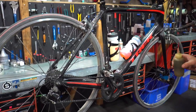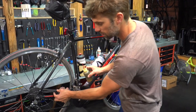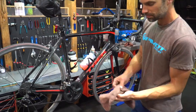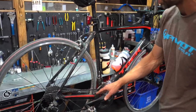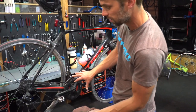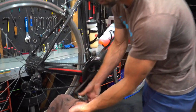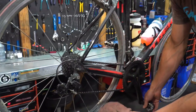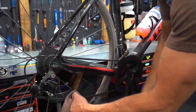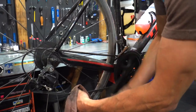Now walk away for a minute — take your kit off, throw your shoes in the house. After that oil has sat on the chain for a minute and really worked its way in between the plates of the links, come back to it with a rag. We're going to take off as much as we can. Jesse's done a good job of oiling his chain but he's not been taking the lubricant off when done, so that's why we're collecting a lot of debris. Wrap the chain with the rag and try to take off as much of that oil as you can. If you see a thick blotch of oil, it's still too much — keep going until it starts to appear more faintly on the rag.